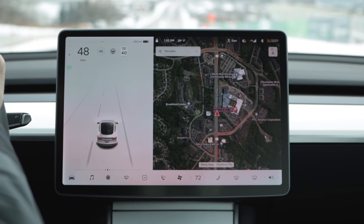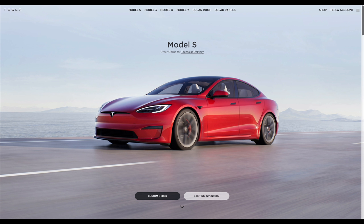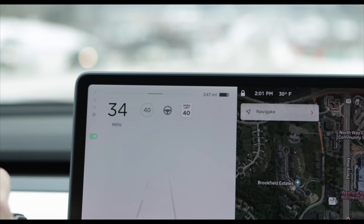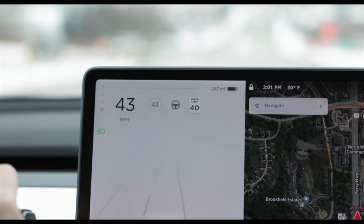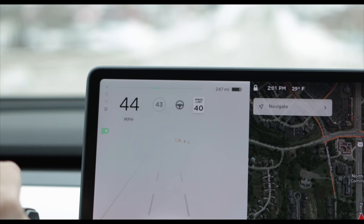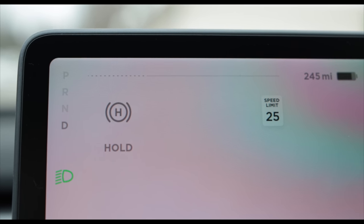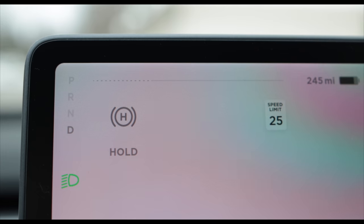Next, I want you to familiarize yourself with the power band, which is conveniently located on the top left of the screen if you're in a Model 3 or Y — this will likely also apply to a refreshed Model S or X. As you accelerate, the power band is black and moves in accordance with the pressure you apply to the accelerator. As you ease off the accelerator, you will see the band decrease and then turn green as the car continues to slow, with the green color representing regen. You can also see that today part of the regen band is dotted, meaning the car does not have access to full regen.